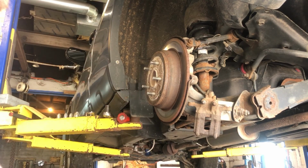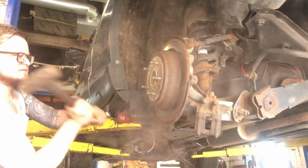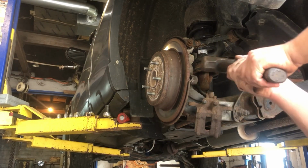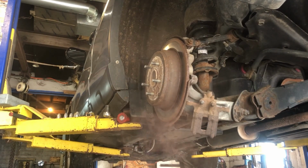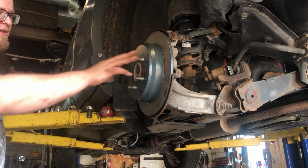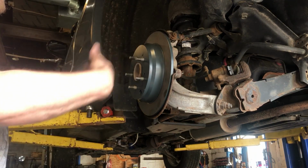But first, smack this rotor off. This rotor is on there. Let's try coming from the back because we got new rotors. This one's gonna take some hammering. All right, we got that old rotor off. There was 2 set screws in there. The one was camouflaged by corrosion. I didn't see it. After I got that screw off, it hammered off easy.